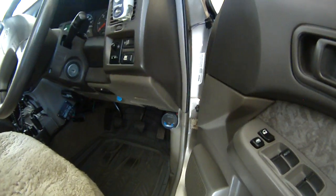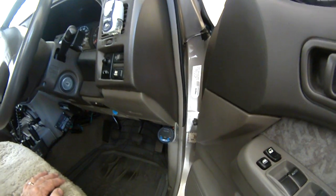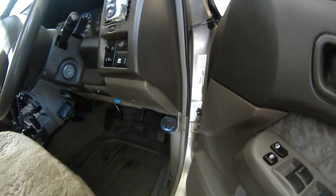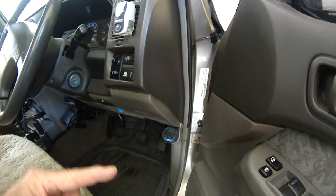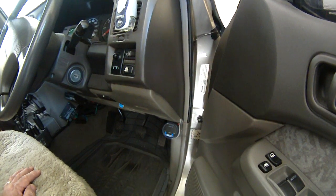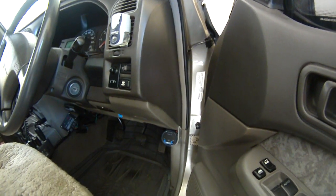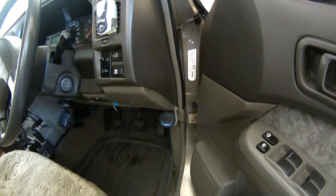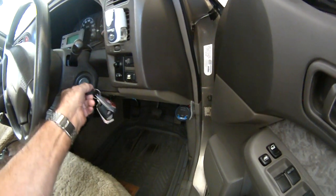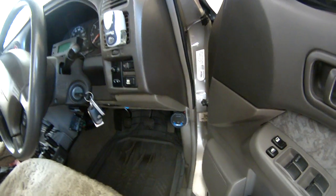This is the cooling mist controller. The two buttons on here are where you set your boost. The injection starts at 13 psi and it finishes at 17.5 psi, and my maximum boost is set at 18.5 psi. So it comes on at 13 and ramps up to 17.5 where it's fully out. I also have a cutout switch for the pump on my centre console, so if anything happens I can just shut the pump down immediately.